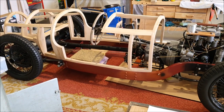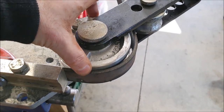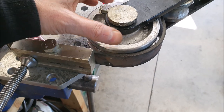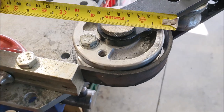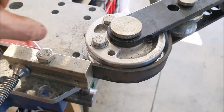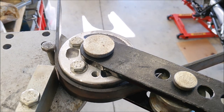I'm going to keep working on these, and then the plan for the rest of the weekend is probably to start making the doors. That's as far round as I can bend that in one go. You also get a little bit of spring back in the steel, so your radius ends up a little bit bigger. This is four inches - about 100 millimetres. What I need to do now is unclamp this, move everything around, and then I can bend it the rest of the way to get a full 180 out of it.